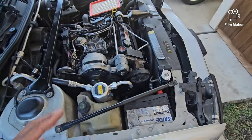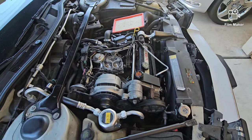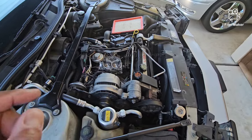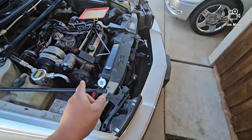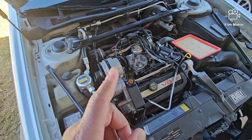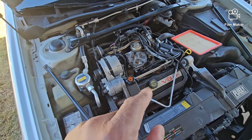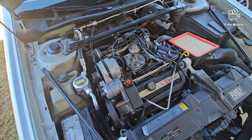The first two early years — 94 and 95 — had the 4.9 liters, with the Northstar as an option, and then 96 onward they went complete Northstar and got rid of this engine. But believe it or not this engine came with 200 horsepower and 275 pound-feet of torque. The Northstar is a more powerful motor obviously, but these 4.9s are way more reliable than a Northstar.